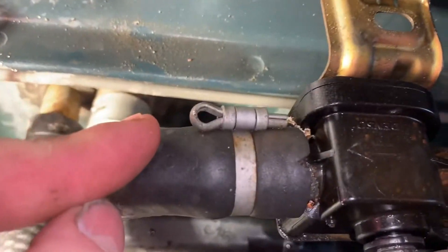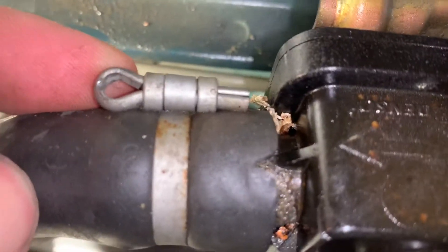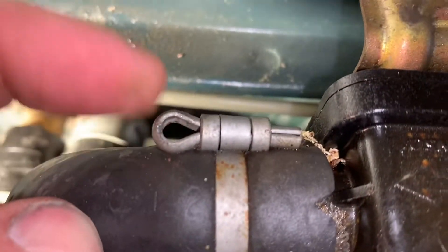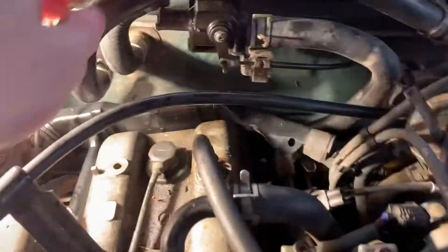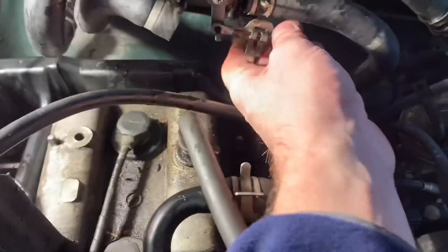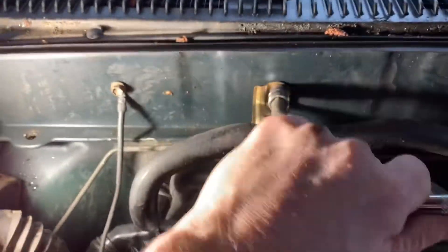Go ahead and get that off. This hose has to come off — it has one hell of a hose clamp on it. I'm going to go ahead and pop that off, just kind of tap that out like a cotter pin type deal. The thing just kind of pulled off — I knocked it off. You can see that side's corroding too. A 10 millimeter socket worked great.